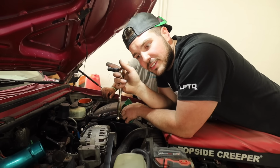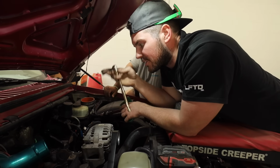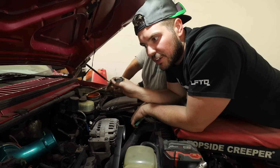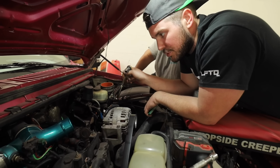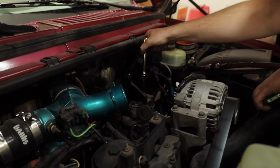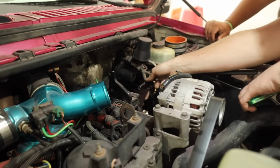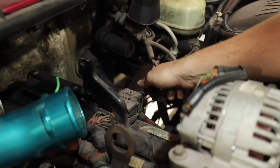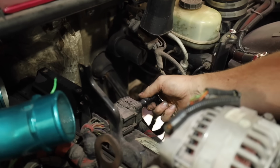Okay, you probably don't have to, but you should disconnect both batteries. Also, the passenger side valve cover is a little more difficult to get to, so take your boost tube and intake tube out. There's this 30 or 32 pin connector here, with a 10 mil on this side. You do this, just like the computer down there when we have to install the chip, and it'll come out.